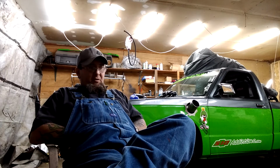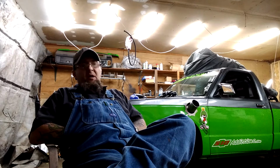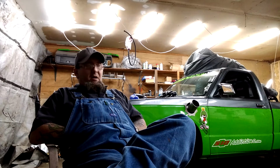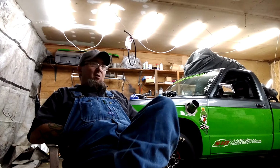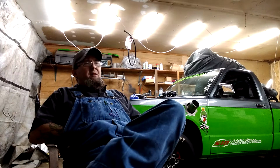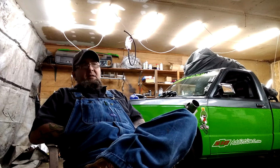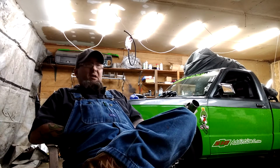It's got the Howards hydraulic race lifters, the high rev, short travel race lifters, 3/8 pushrods, one piece, hardened. I think they're like 120 wall. They're thick walled bastards. I know the pushrods, it was $170 for the intake and $170 for the exhaust, because the engine machine shop got them.